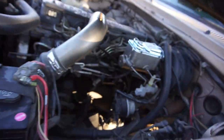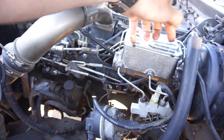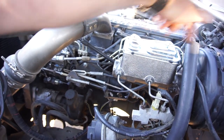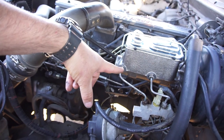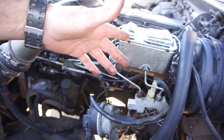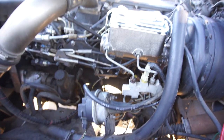When I got home from picking it up, the kid already had it off his truck. We stuck it on, but first we had to bench bleed it. If you don't know what bench bleeding is, basically you stick it in a vise, fill it with fluid, stick some hoses in the ports and loop them back into the reservoir, then pump it to get all the air out so you don't push air into your brake lines right away - a lot less bleeding to do later.